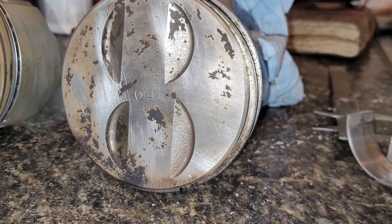That's okay though, because that's actually ideal. I didn't want to buy pistons for a standard bore block to build our stroker. I have a 331 stroker crank over there — it still needs to go to the machine shop. I didn't want to buy standard bore pistons for that stroker crank, but I would buy 40-over pistons for a stroker crank.